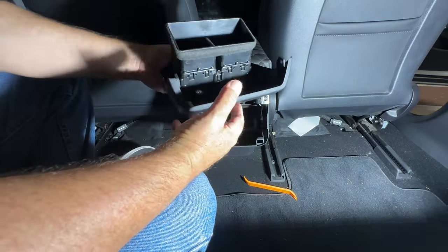All right, so the cable I'm talking about is this cable. It's a second cable that comes with the kit. You just unfold it. There's a single end here. This will go to the central control. And this one that has the two ends, this is the pigtail version that's going to tie into the existing seat controller and then let you control the seats. So this is the part that's going to go over to the front passenger seat. And then this is the part that's going to stay here. So I'm going to fish that all. And then I'm going to start to put the covers back on. And before I plug anything, I'll put the 7-inch display on.